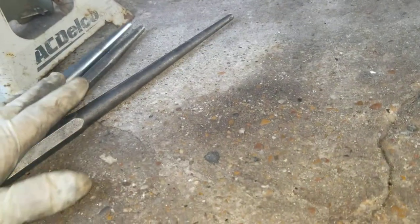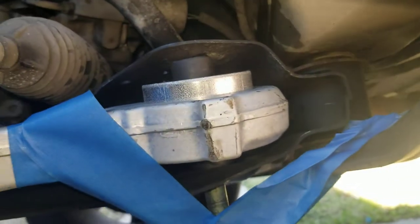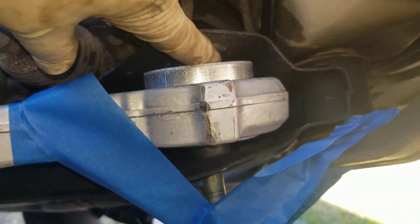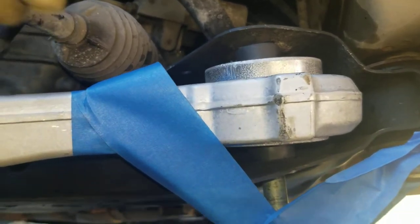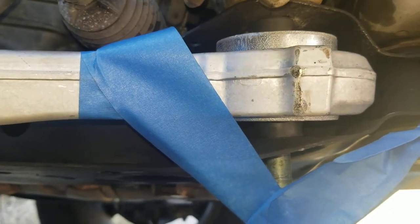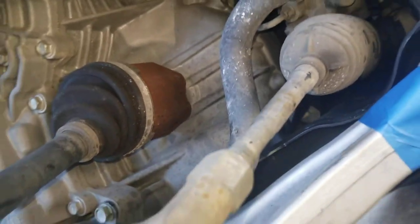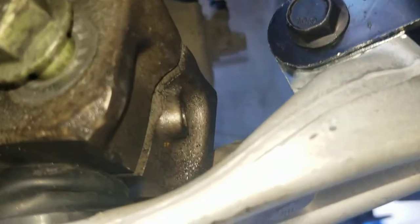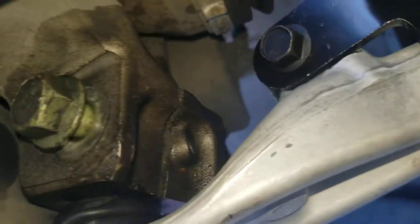I've used some pins to line up the holes for preliminary alignment. With the new bushing on there, this sleeve here is really tight. What you're going to have to do is jack the car up with the wheel on, put all the weight of the car on the wheel, and get this control arm to flatten out so you can get the bolt lined up. I've used masking tape to hold the bolt in place with the bottom holes lined up, but the top hole isn't going to be lined up — it's got about an inch to go. I'm going to go ahead and torque this pinch bolt — you don't want to forget to do that.